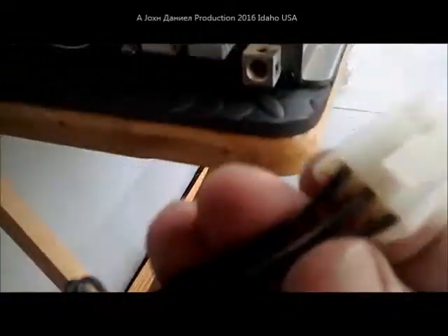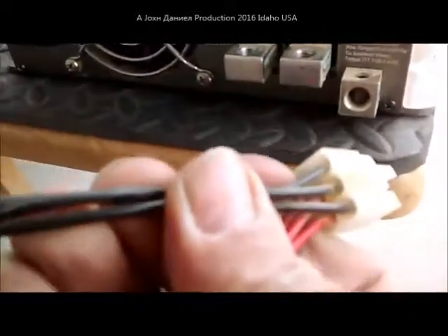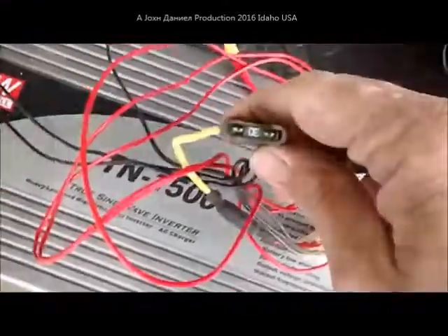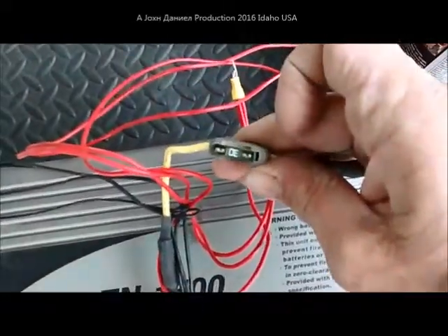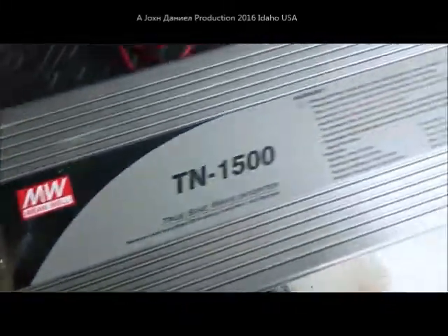Here is the scenario: there is the plug and it has three little 14-gauge wires that will handle that. What I did with mine is I just put a 30-amp fuse in-line, and that way I was able to swap out the fuse if it blew from outside of the unit.